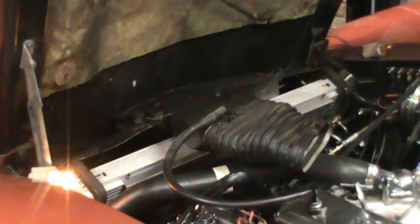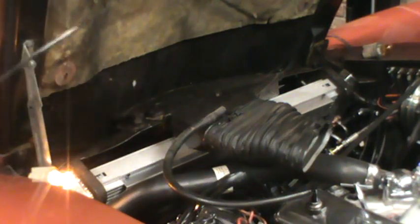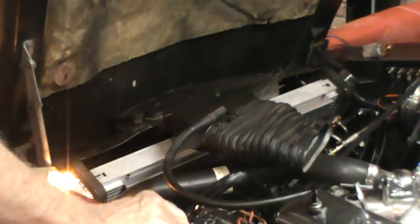So in investigating that, because of the fact that the turn signal was coming on, but it was blinking slowly, just like it did in the back, I got to investigating for grounds and found a wire that was loose. And I had thought when I put the body back on that, since it was laying over here, that it was from the aftermarket alarm system that I had taken out.